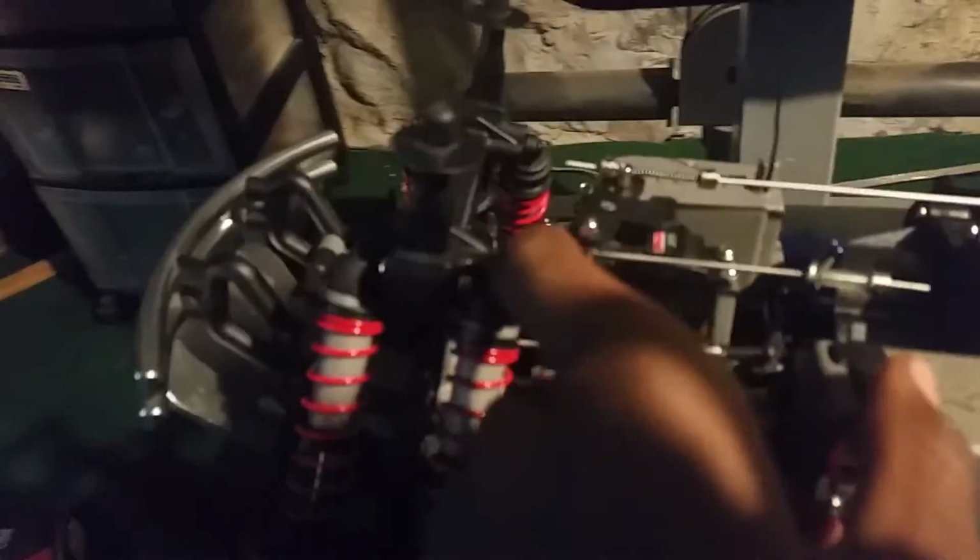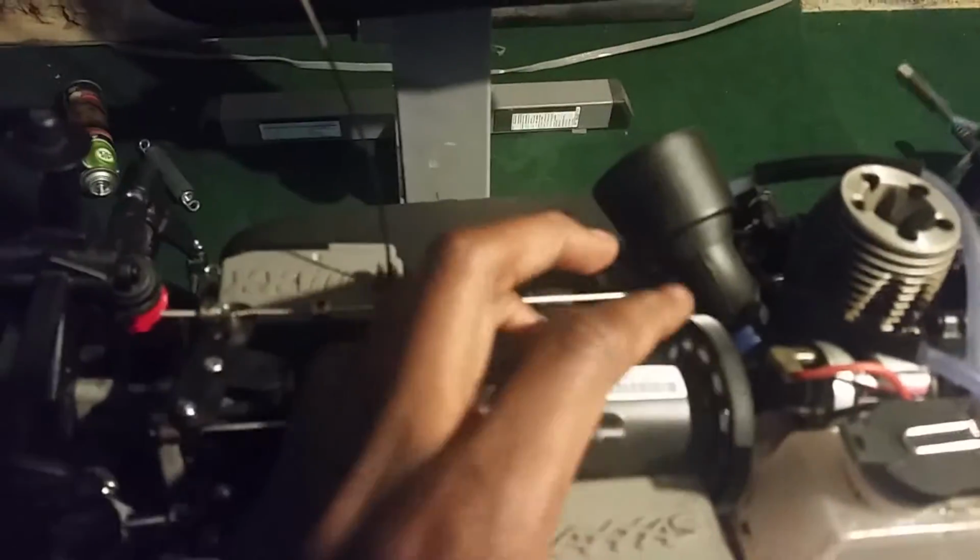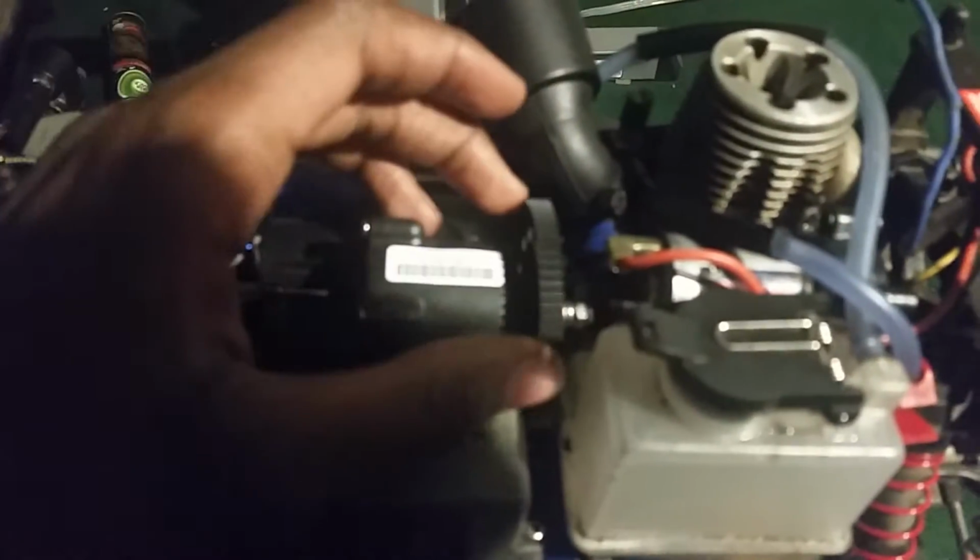Let's start by opening up the transmission, and you see this little gear right here, the spur, I think, that's on this little shaft. I think there's a pin that goes in there. I put it back in, so that's one thing. Another thing is the linkages. I took an Allen key, unscrewed this, and slid the brake linkage down so it would be shorter and easier to brake the engine. And you see that? I just tightened everything on it and made things shorter.